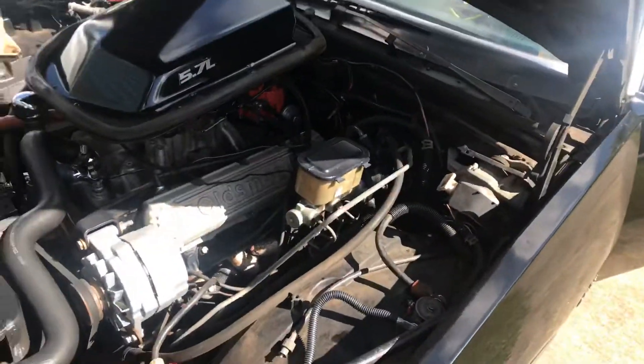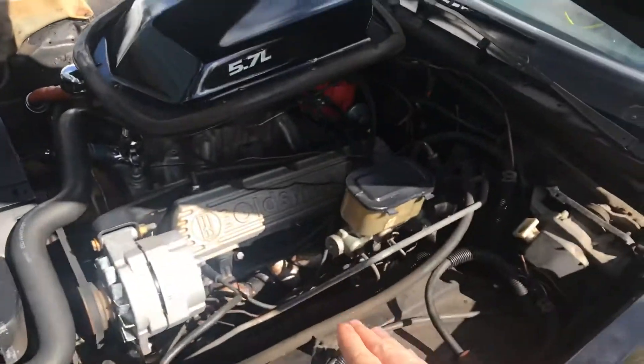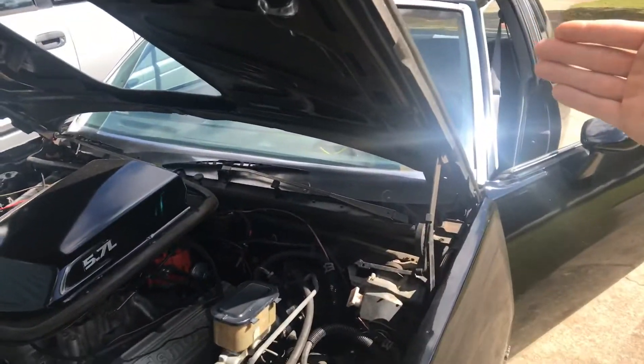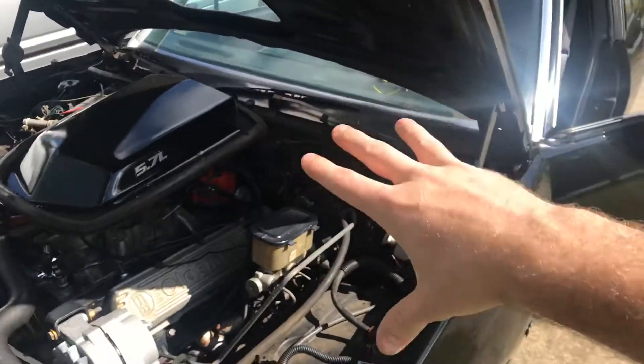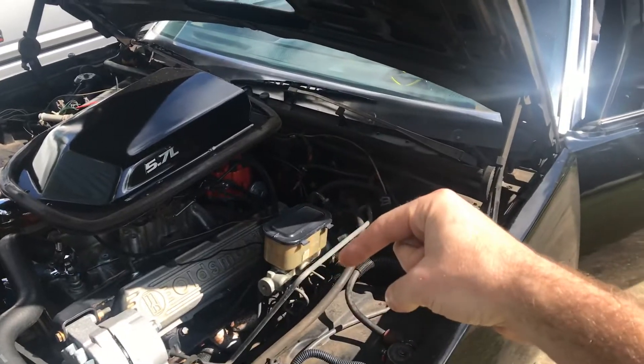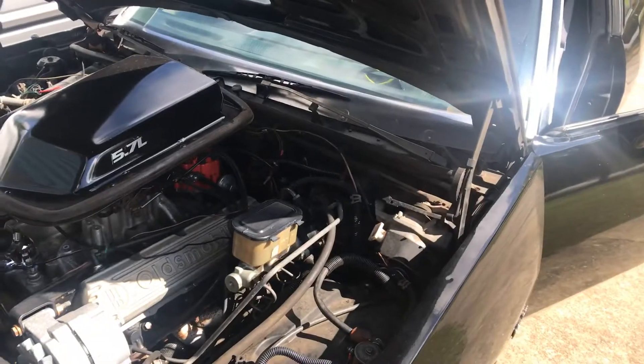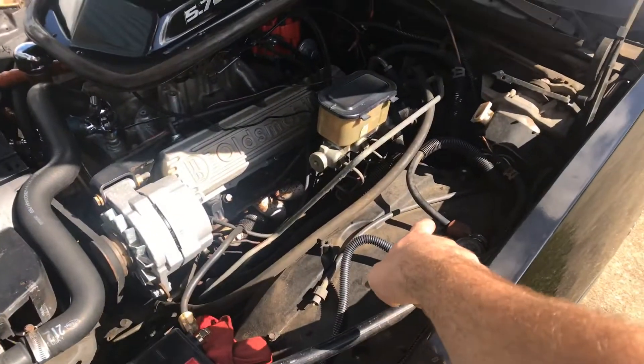Obviously I wanted to kill all sources of 12 volts going from basically the starter into the cabin, because your cabin power traditionally taps in onto your starter right next to your feeder cable going to your starter.